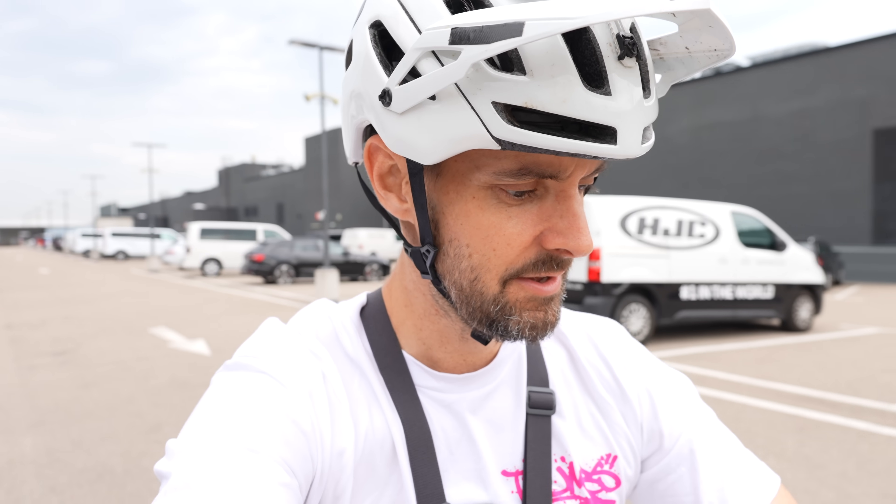Next I want to try shifting under load — really burn through that gearbox and stress it out. I'm in the highest mode, shifting manually under load. Between gears eight and nine there is a slight clunk — it's like having a front chainring and rear derailleur shifting two at once, so that one is a little more aggressive. Between nine and twelve it's completely seamless, like an electric car without any gearbox at all. Between ten, eleven, twelve it is so smooth you cannot tell you've shifted at all.